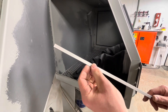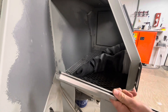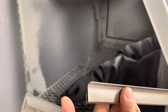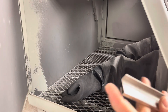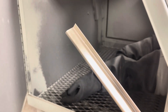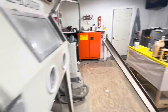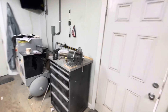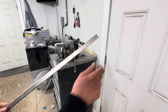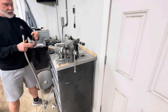I'm going to black metal etch this one because it's so pitted. You can see how pitted it is — also this edge is a little long and kind of chopped up. I think I might grind that down a bit smoother. I'll work this over in black metal etch, and that'll be adequate for the glass channel because I don't think it's ever gonna look like it needs to otherwise. I'll set it up in the vise, blow it off, wipe it down, and shoot some metal etch on it.